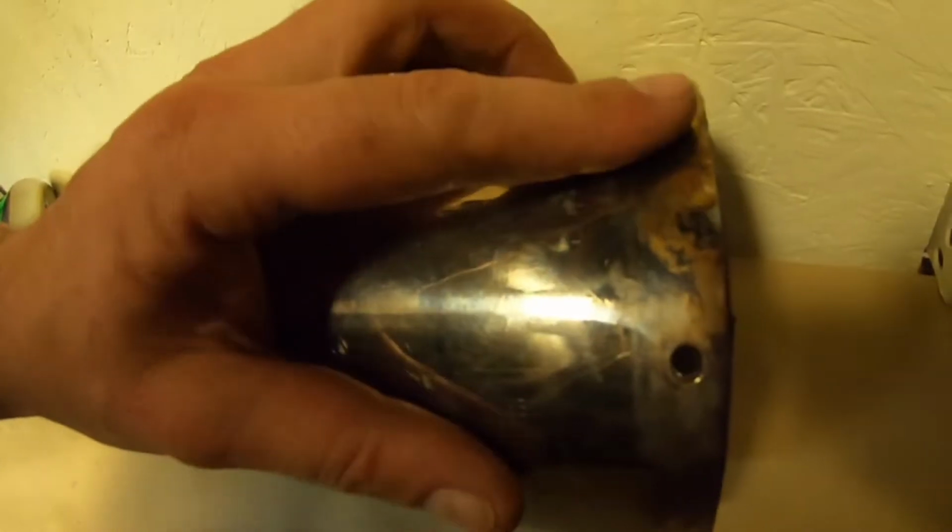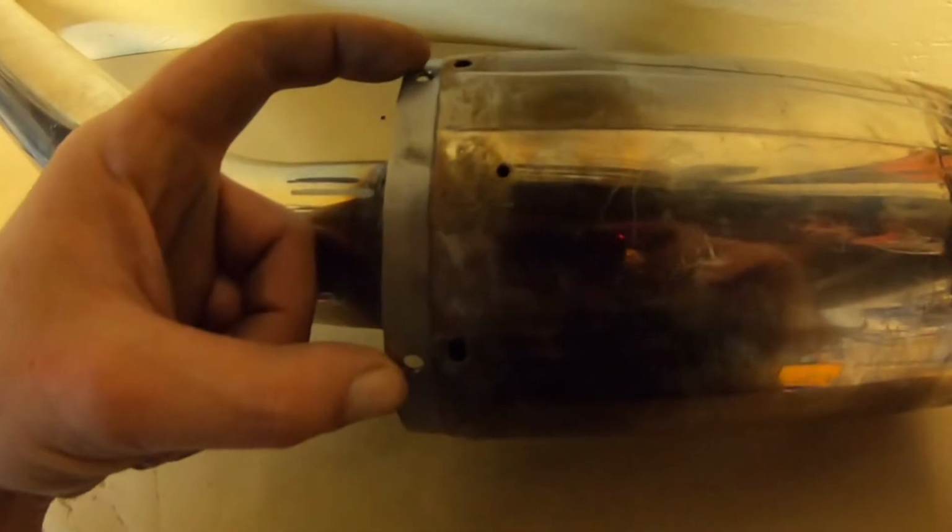The reason I've not put the trim back on myself is because if you do get it out of line, then you can readjust this trim to suit. Just makes it a bit easier in the long run, but as long as you mark everything up, it should be good. So I've done a double mark line on mine. It ain't got to be the straightest, just because you can only get it out so far anyway. So marks are up, just makes it easier. Like I say, you can put it all back on the bike and go from there.